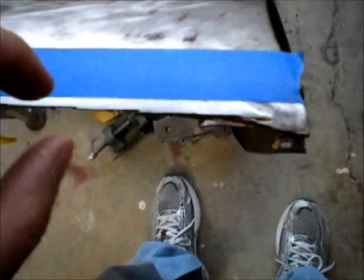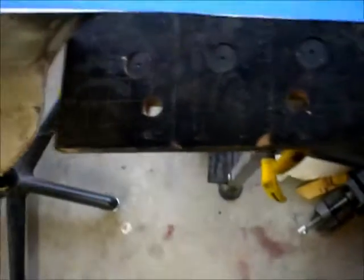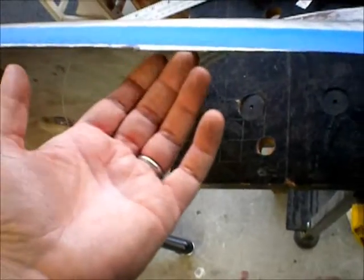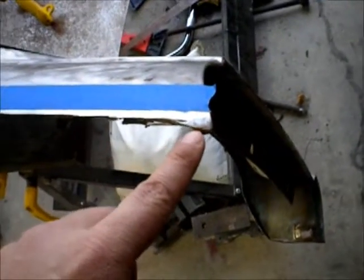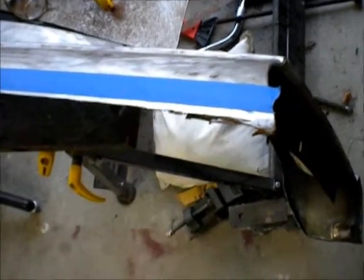So that'll be thicker by about a 1/2 inch. It'll stick out by 1/4 inch, I should say. And then I will cut it to fit. And I'll re-weld the flange on that I'm going to make with the pattern that I've got. Because it'll be flat and sticking out, I'll be able to work that and make sure that I've got this top profile that I like, the curve, where the curve meets the flange. Like I said, this is the tip here where I cut it at an angle after I realized where I screwed up, so I might as well complete it. So we'll see how that looks.